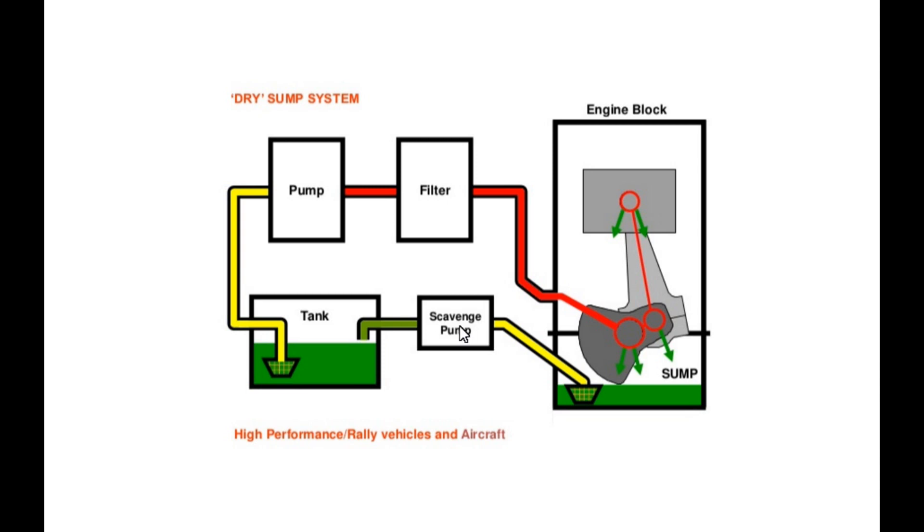What we have is a scavenge pump that pumps out the minimal oil in the sump and feeds it into a separate oil tank which can be located anywhere on the car. On my car it's on the passenger side, which helps with weight balance — giving the manufacturer another option for balancing the car. You can make this tank just about any size and shape. Most manufacturers make it taller than wide so it's less susceptible to slosh. From that tank, oil goes into your normal oil pump, then through the oil filter, and is squirted where it needs to go.